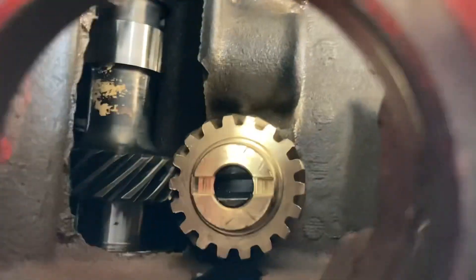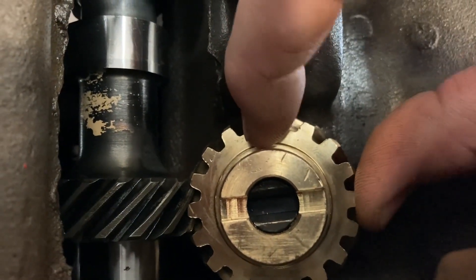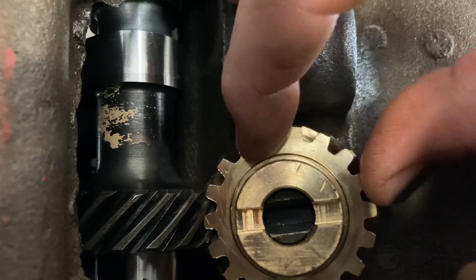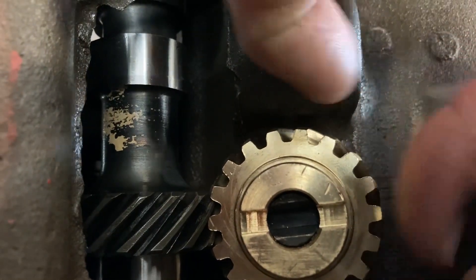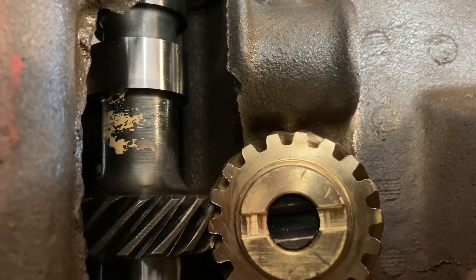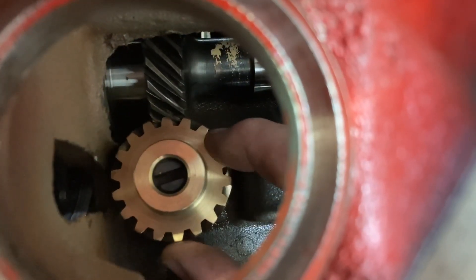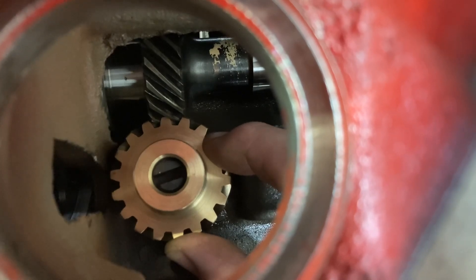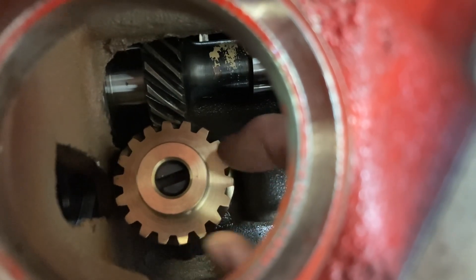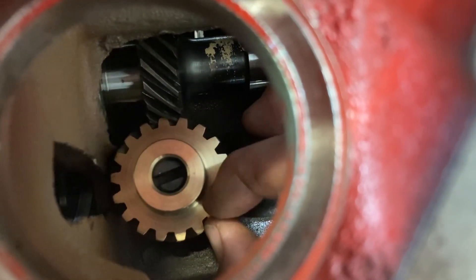Let me get you a better angle. There we go. I'll steady it up, grab my gear, and you can see that amount of movement. Yes, this will be full of oil and that will dampen some of that. I thought maybe this gear on this cam is a little worn — this is a used cam, but it's really in good shape. Now I'll drop my Milodon in. The Milodon still has just a little bit of slack there. At a certain point there has to be slack there — it's just like anything — there has to be some kind of backlash or slack between the gears so they don't eat each other.